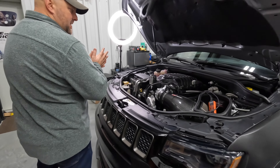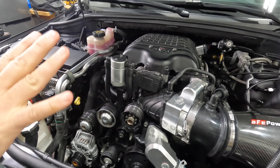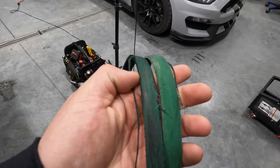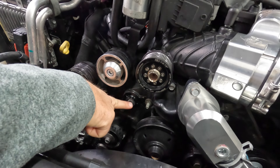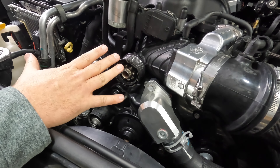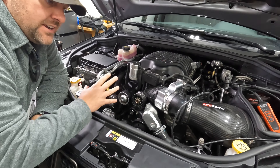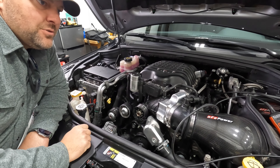If you guys don't know, if you just watch our channel for the GT350 — we did buy a Trackhawk, built everything, demon blower, and we slung some belts. This is about half as wide as it should be — it's a 10-rib and a 6 and a 4. What happened was a bolt broke off inside the water pump right here that holds the big tensioner, and when that snapped it messed up the water pump, like all kinds of stuff slung everywhere. So we ordered all the parts to fix everything plus some upgrade parts. This is about 1,200 crank horsepower, 970-980 at the wheels, so this will be a really good race for the GT350.